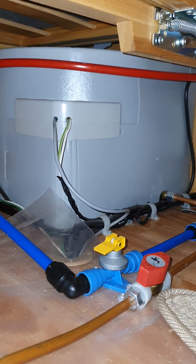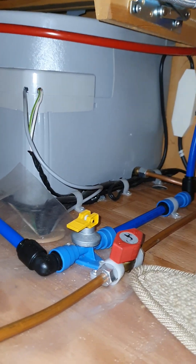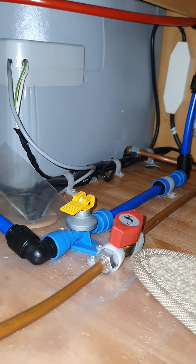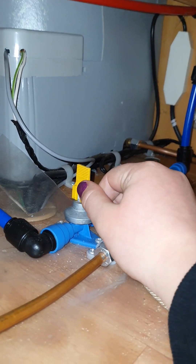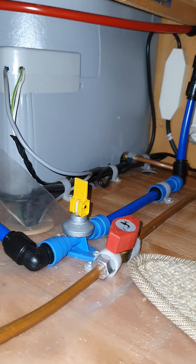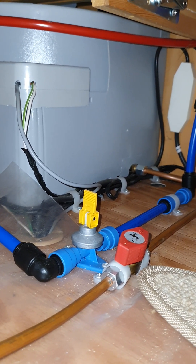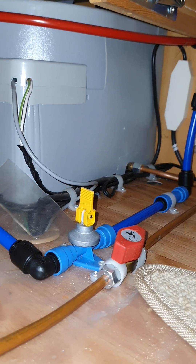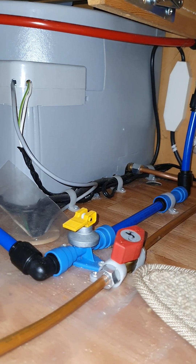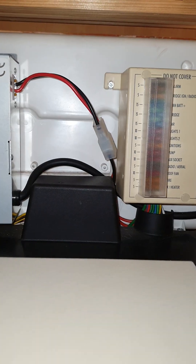Just under the front seat on the oven side of the van, this gray unit is your water heater. As long as you're using the controls up by the dresser, it does its own thing. The only thing to know is this little yellow switch — when storing the van, especially over winter, flip that switch up and it'll drain all the water out of your water heater. It's also a good idea to open all your taps to get any remaining water out of the system to stop anything from freezing and bursting. When you come back to use the van, make sure you flip this switch back down — if you don't, all the fresh water from your barrel will be pumped straight out through the floor.